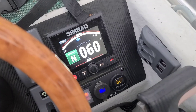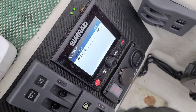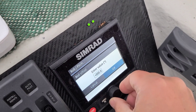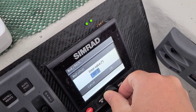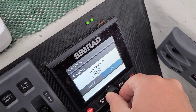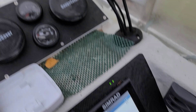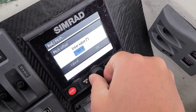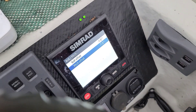Let's start with the calibration on the ground. When I'm on the ground on the trailer, straight, I have pitch one and roll one before any calibration. Now I have zeros here and I think we will set minus one. We will set the rotation up.